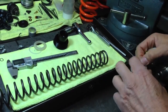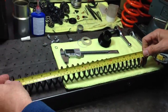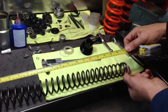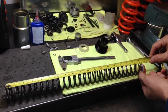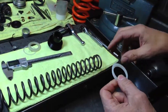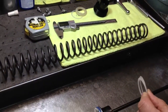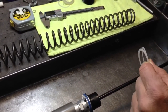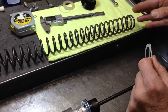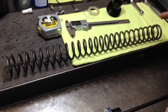It's got two 1.5 millimeter spacers added on to the end of the spring. The way you would measure the total length is just put those together — and this actually ends up being about 471. The problem with doing this, even if you buy a new set of springs and just want to pull them out and put in new ones, is you can either assume what the spacers are inside there, because they're different and you never know for sure what's in there. All springs don't end up the same length when they wind them, so even though they say 465, these are 467s — they could be right on the money at 465, could be 464, you just never know.